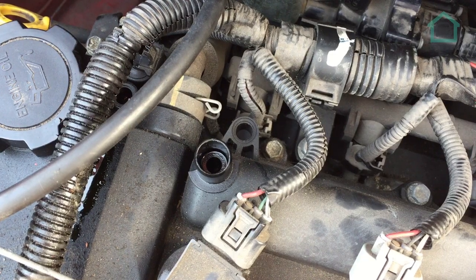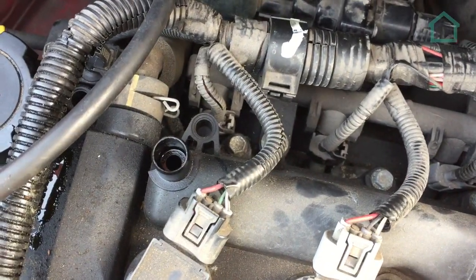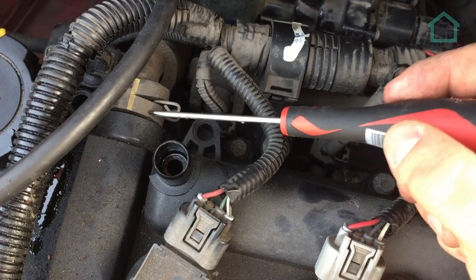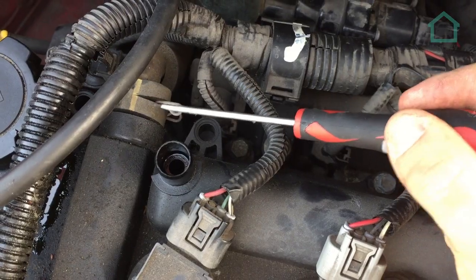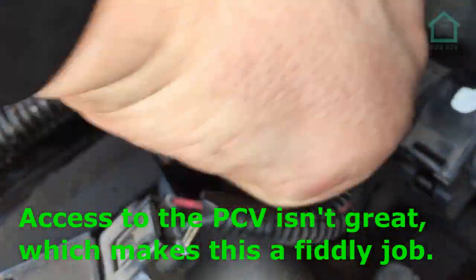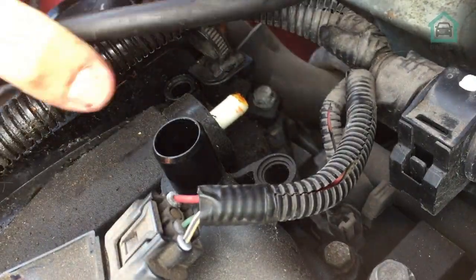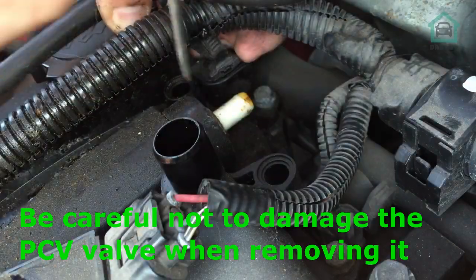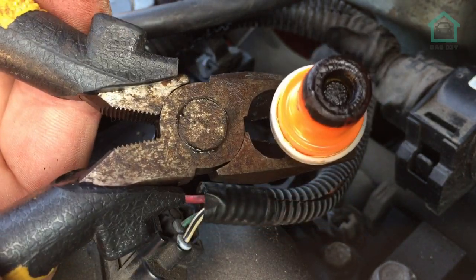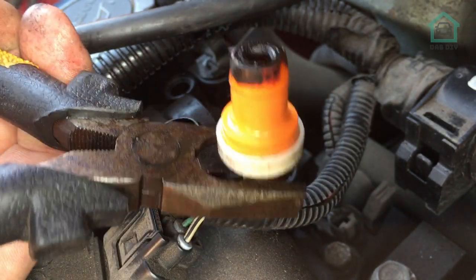I've been speaking to a friend of mine called Chris — link to his channel in the description — and he suggested we might do the PCV while we're at it. Here's the PCV hole that goes back into the air circulation system, towards the air filter and back through — all the emission stuff. Just inside there's a little valve we're going to take out and clean. We squeeze these, push the whole thing back and it should just pop out. There we go — you can see how nasty it is in there. Oh, that's disgusting!